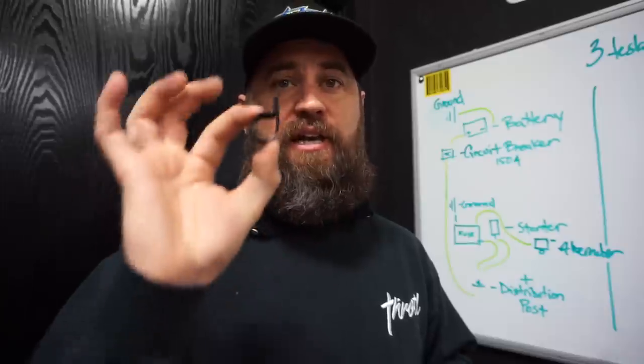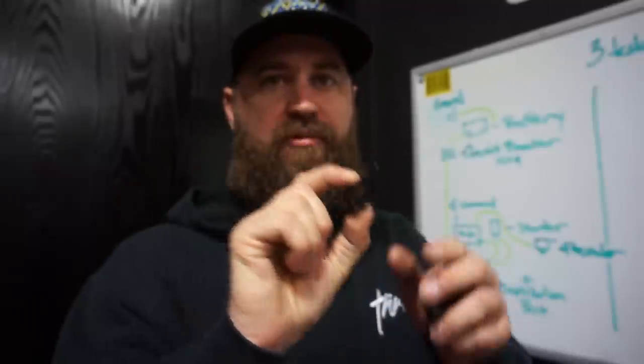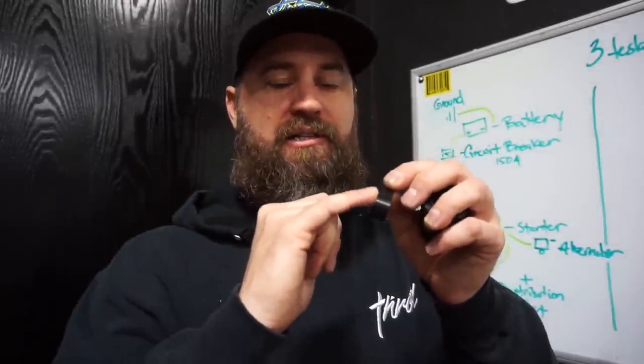If you're passing the wiring underneath the car, or even in the car for that matter, you can utilize a D-type wiring fastener like this. It has a hole for mounting here. You can use self tappers or fancier if you like. These are plastic versions. They also make metal versions with a rubber isolator on them.